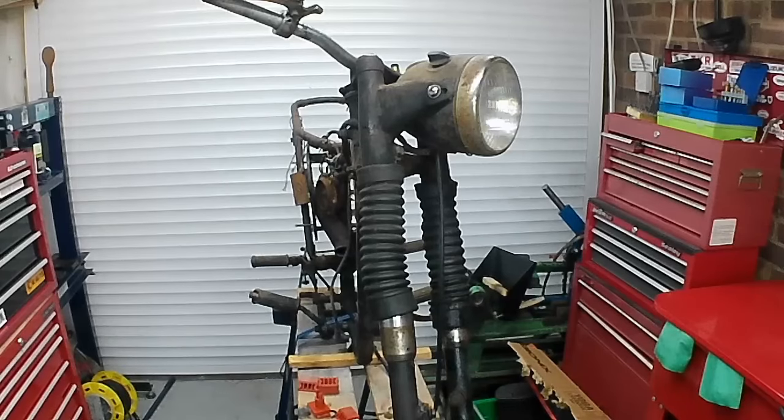That will help us with our strip down. I think we'll then move on to removing the front forks and the rear swinging arm, and, well, there isn't a front swinging arm, is there? Let's be honest. The swinging arm, and then everything can have a really good clean. We'll take the frame outside, give it a good blast down with some bike cleaner to get all the filth off of it. Ditto with the bits that we remove. So, yeah, enough talk, bit more do. I shall gather some.